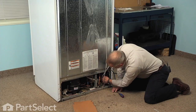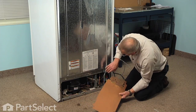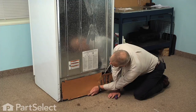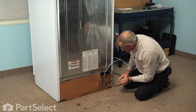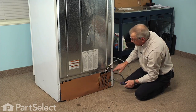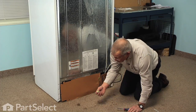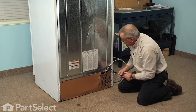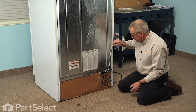Make sure the wire harnesses are still connected properly. Then take that cardboard back panel and tuck the top of it into the little channel in the back cabinet, then replace the screws. If your model had the breakaway style valve, you can use the adhesive strip that was packed with this kit and cover over the opening where that connection would have been cut away. Use the screw with the large washer on it in the middle. Now we're ready to push the refrigerator back into the opening, reconnect our water supply, turn the supply on and check for any leaks, and reconnect the power.